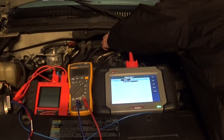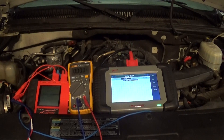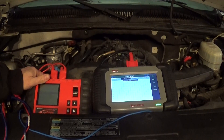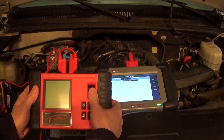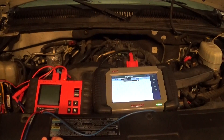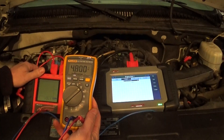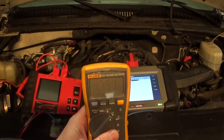I was thinking — is there any other way to do this other than jumping our 5-volt reference voltage? Is there a safer voltage source we can use to test the signal wire? I was looking at this Vantage Pro — this is an old Snap-on Vantage actually. When we set this tool to diode and continuity mode, this tool actually uses about 4.8 volts. I have my voltmeter hooked up to my Vantage Pro so we can see the voltage that this tool uses to perform the continuity and diode test — it's using 4.8 volts.